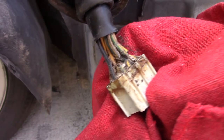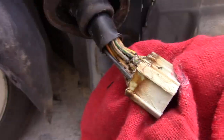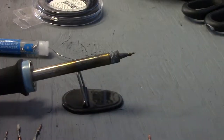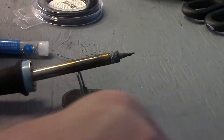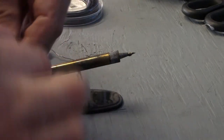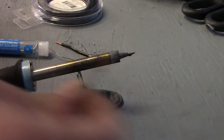I might try to go to the junkyard and pull another one of these clips, de-pin these, and cut the wire up further and splice it in. There are lots of different ways to connect wires together. One way I've always done it — since I'm working with such a small piece, I'll do it this way. A lot of guys will twist the two wires together, almost like a knot, and then solder that knot so it pretty much won't ever come apart. I don't really have enough to work with to do that, so I am going to solder these.